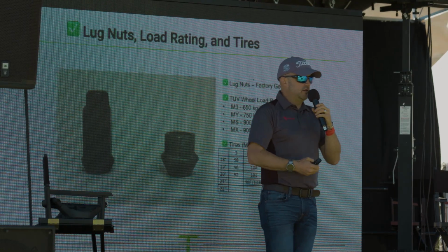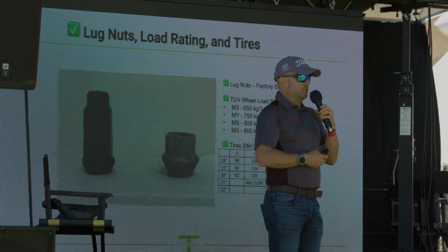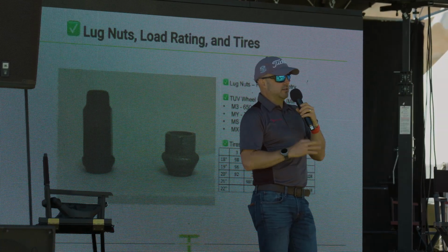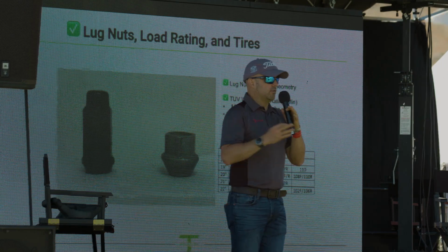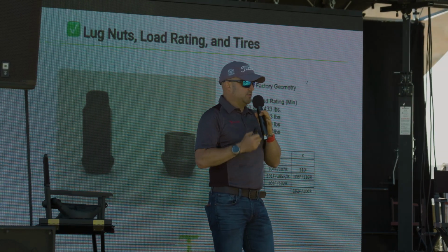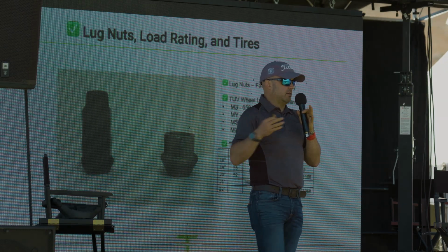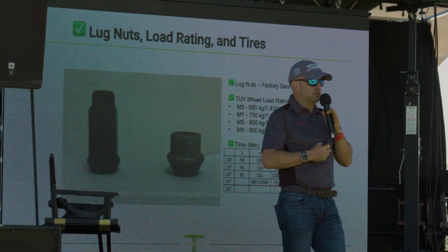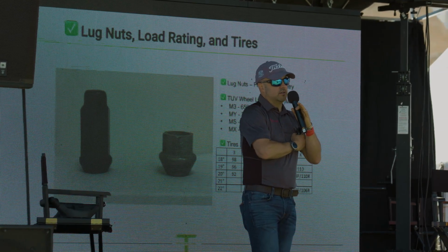You need the TPMS. You need to keep the tire pressure up. You need a tire that's rated for the car, not so much the foam. And as far as the width goes, that's where you're going to start to impact range. If you put a wider tire on, you're increasing the surface area that faces wind, or air resistance, all the time. You're going to lose range.